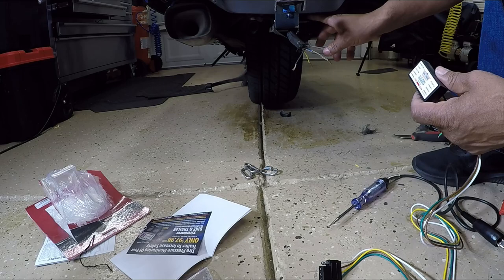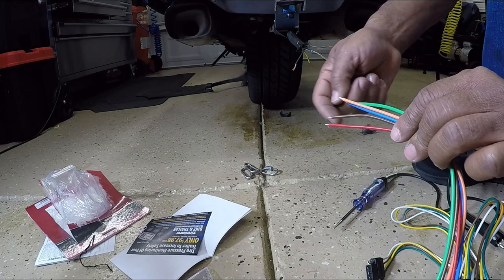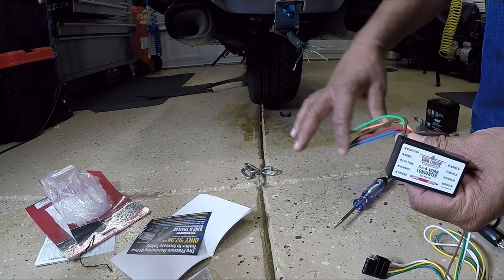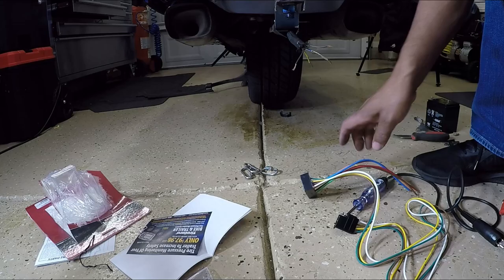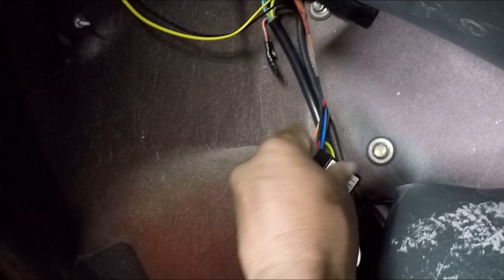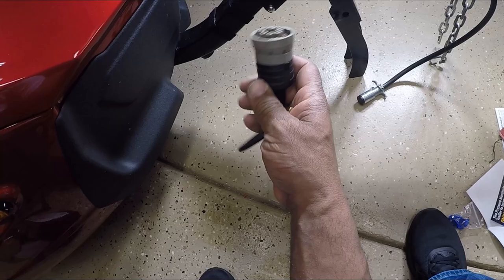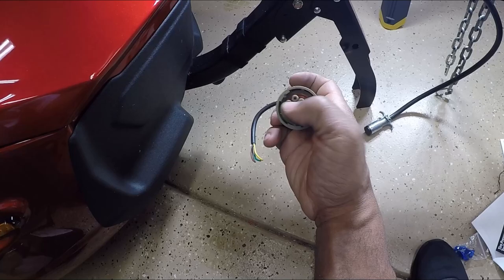You've got to either put the converter box under your seat before it comes out of the bike, or you can put it in the trailer. If you've got five wires coming out of your Goldwing, run your output into the converter. Looking inside my trailer, there's my converter box — I ran it on the front of the trailer down in a little crack at the nose of the trailer where it wouldn't get smashed. I just laid it down in there and covered it up.